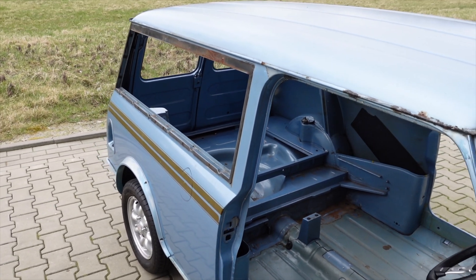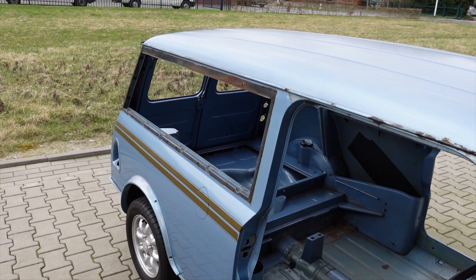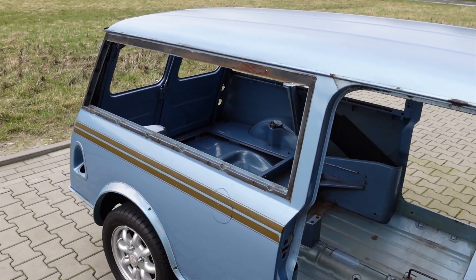The work that's been carried out looks pretty good, so it's going to be a couple of months before we see this again. The electric drivetrain we've gone with is actually a passive system, which means there's no water cooling or generated heat from the system itself. That means we have to pay attention to meeting the regulations for de-misting the windscreen and creating some heat inside the cabin for personal comfort.